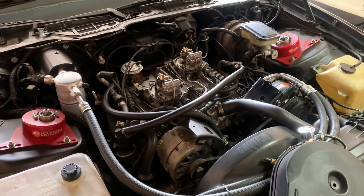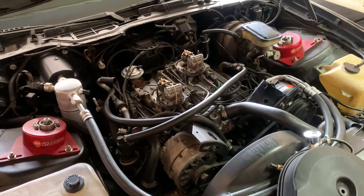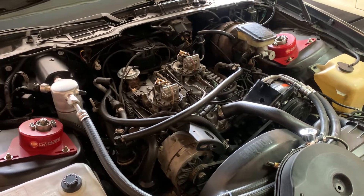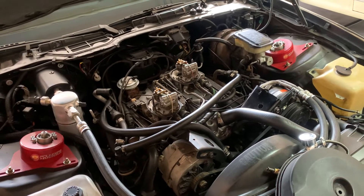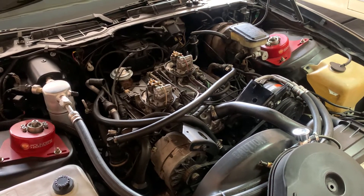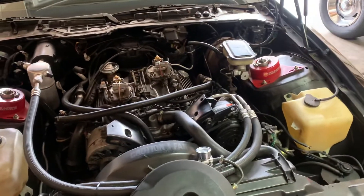If you don't want to do this, you can certainly try running an '85-and-up LB9 or L98 fuel pump out of a tune port car. But from what I've seen messing with these things over the last 25 years, you're probably going to be still stuck with low-ish fuel pressure. I've heard of guys running as much as 20 pounds with an aftermarket regulator assembly, but for the factory-style fuel pressure regulator and a basically stock motor — even with a mild cam — you can definitely get by with 13 to 15 pounds of fuel pressure, which the factory fuel pressure regulator will definitely allow.